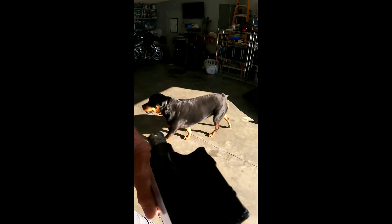You can see here in the light — there's a piece of bar stock welded to the front of the stand, which raised the stop up a little bit so it'll sit at about that angle, giving you about one inch off the tire. The other thing you need is a center pin — it's a 17mm diameter. This one fits almost to the outside edge of the new bushing, so it's going to need to be about a quarter to half inch longer to go through the new outside bushings.